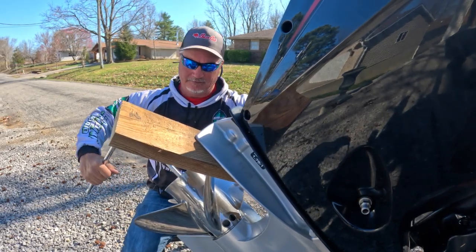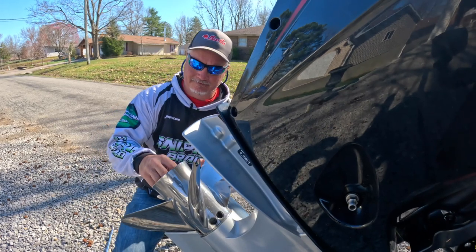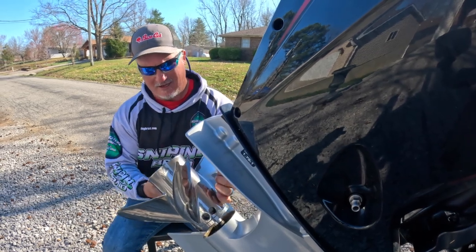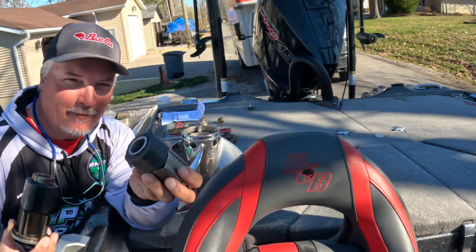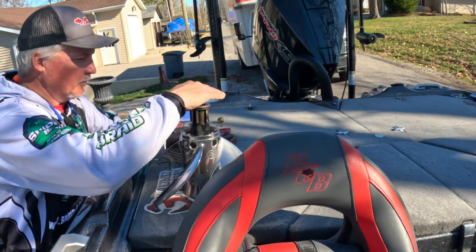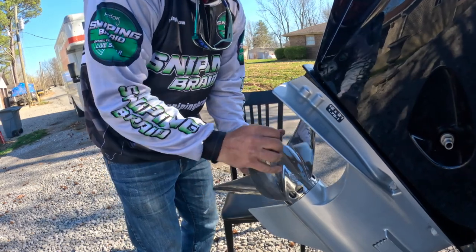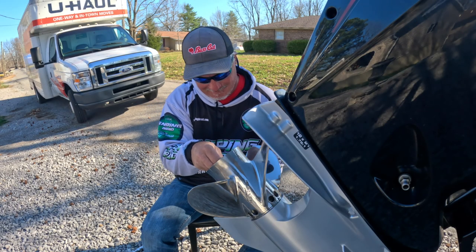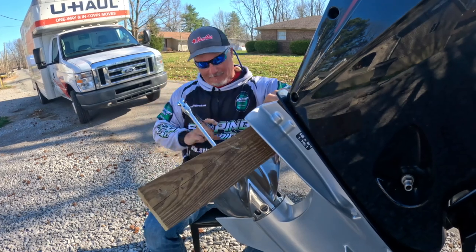Breaking it loose — there it is. Now we're taking off the main nut, nice and simple. We will be replacing all these parts; there's your nut. And now followed by your prop. Since the people that sent me my prop sent me the wrong hub, I'm going to go ahead and reuse the other one — I just impact it out. Now let's insert it into the new prop. Once we have that nice and flush, we go ahead and insert it back onto the motor. Putting the washers back on, then secure it with a block of wood nice and tight.